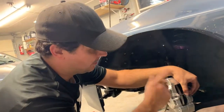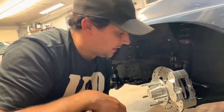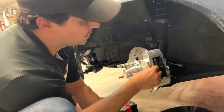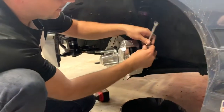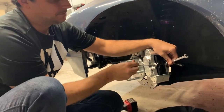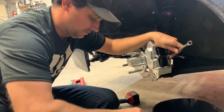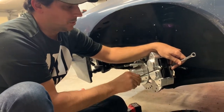So we got the shims all lined up — good clearance on both sides with the feeler gauges. Now we can just drop in our brake pads, which is awesome. You just take the little pin out and then you just drop these guys in there — they can only go in so far, so they just drop right in. That's why I love these — it reminds me of my snowmobile. There is a lock nut on the other side, so you just want to bottom it out and you're good to go.